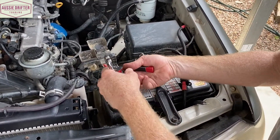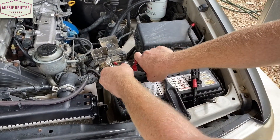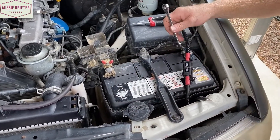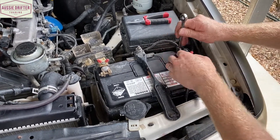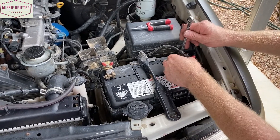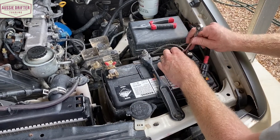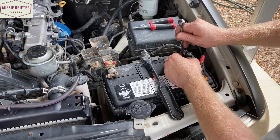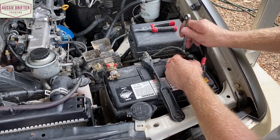This one's been changed to a wing nut so I'm just going to loosen that for now. We're dealing with a 10 mil over here. You can do one of two things: fully take this bolt off, or if there's enough stud there, put your terminal on and add another nut on the end of the stud. Alternatively we could go to the body ground, but it's best to connect directly to the battery terminal so the full current to the charger runs straight from the battery.